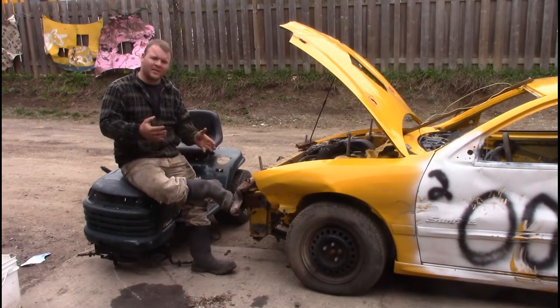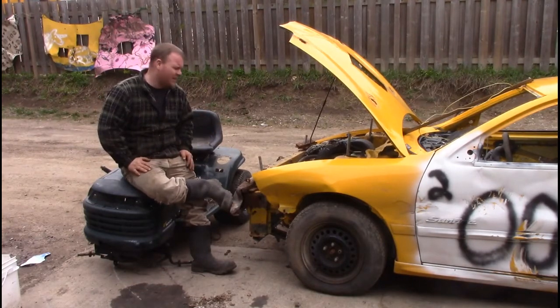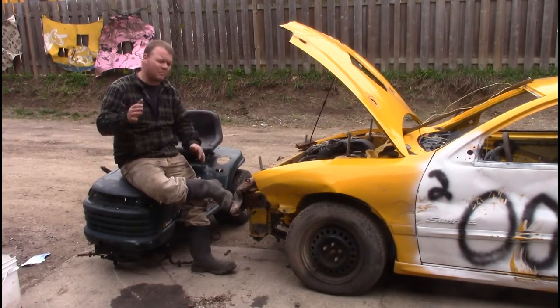I've done in the past where you take the strut out, take the spring right out, cut a large piece of steel, put it inside the strut, weld it. But you know what? I've done that, and I've got to the derby, and the promoter says that's called reinforcing, because now you've added a large piece of steel inside the strut, and it can't bend.